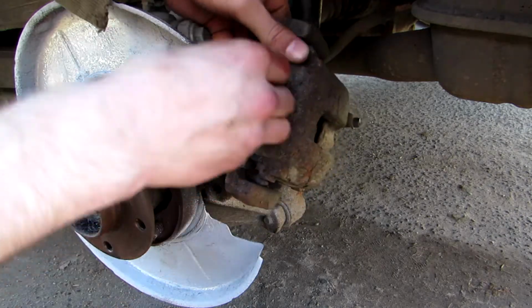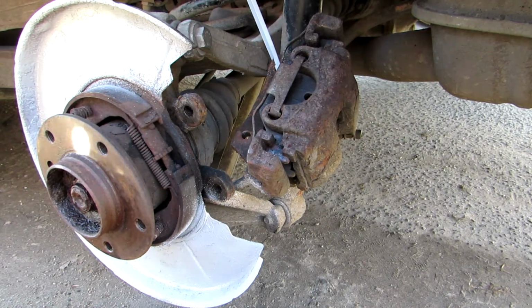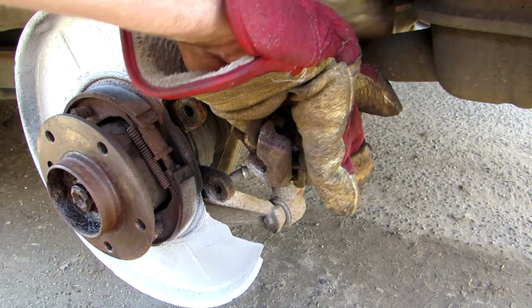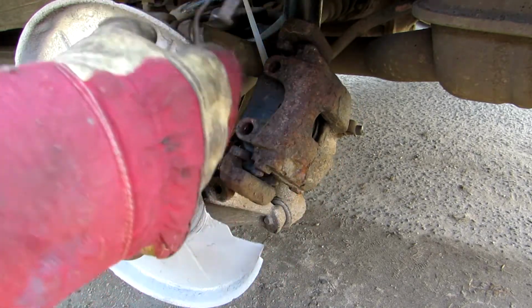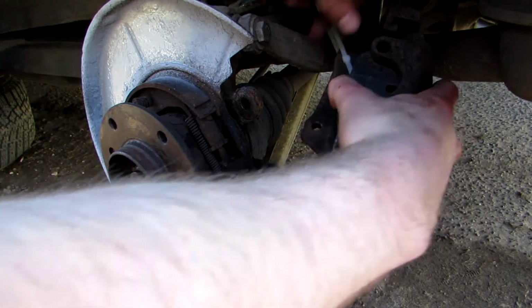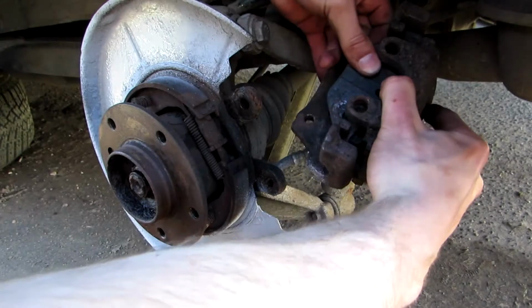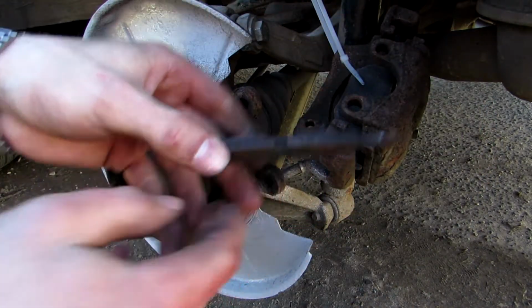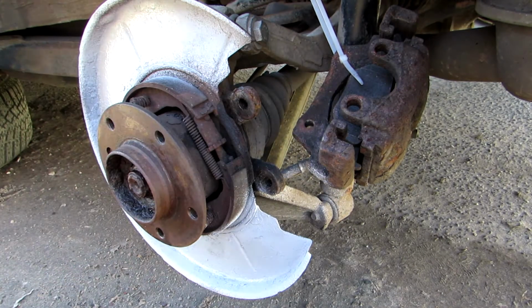First, just take this out. Just push one lower, one upper. Just take out the old brake pads. They should come out rather easily. Just try this one, the nuts, and then just slide those out. See how they look. Looks like they are damaged and old, or not.